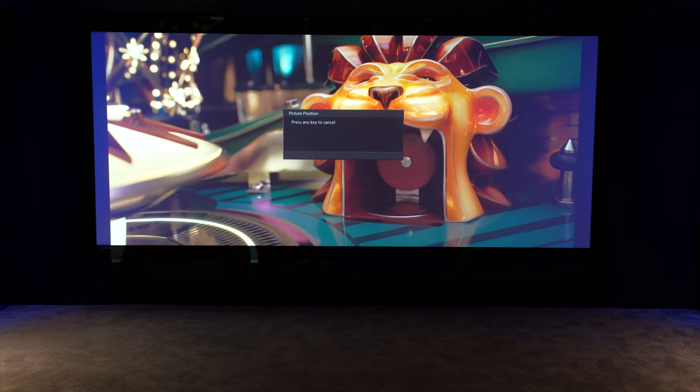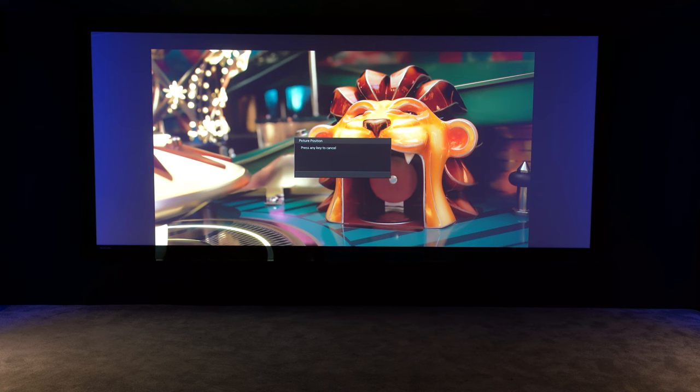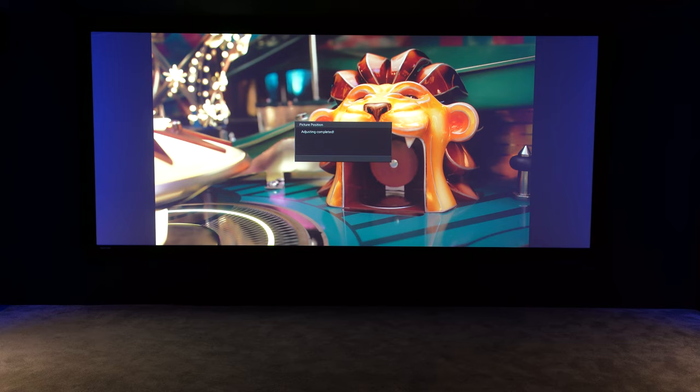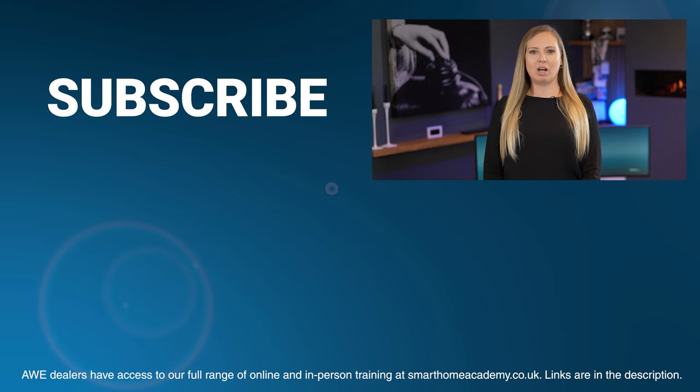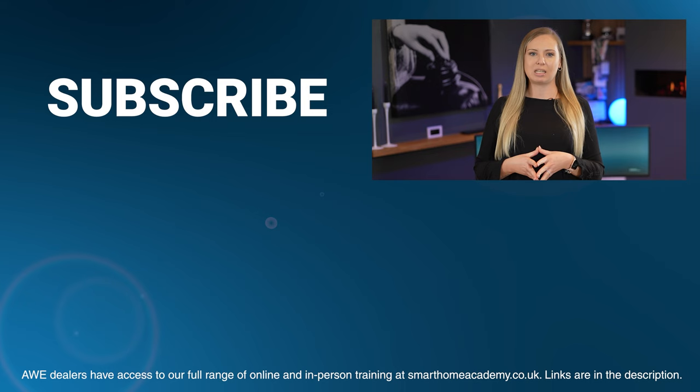Check with the test pattern again — now that looks far better. Excellent. Always worth checking again, so we'll go back to the 16 by 9 position and we're done. So that's how you set it up. You can see it's a little bit quirky — it doesn't always land perfectly first time. What we're doing is going to an extreme point, right to the top or right to the bottom of the shift, and then going back to the middle so it's got a relative point to start from. Once it's getting pretty close, just a couple of ticks to tweak and after a few goes it lands nicely. Hopefully you found that useful — if you've got any questions pop them in the comments, check out more videos below, hit the like button, and subscribe and click the bell icon to get notified whenever new content is released.